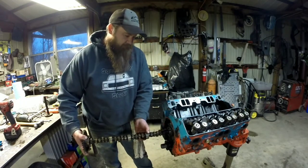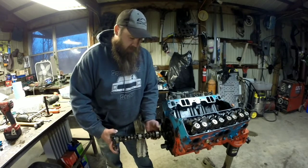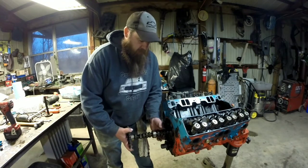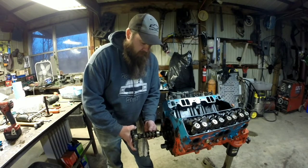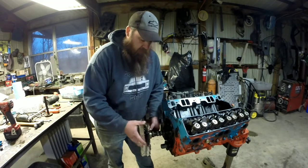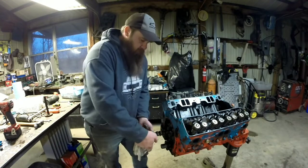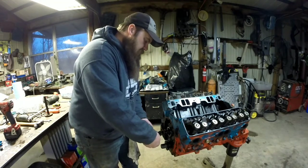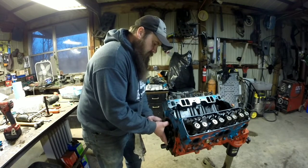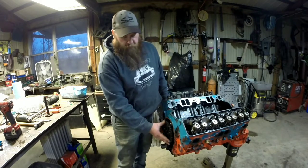I'm going to go ahead and put it back in, same way, with the gear. You may not have a special tool or holder to bolt on the end of your camshaft and you just got to use the gear. And you can do it with just the gear — I've done it with just the gear for a long time. Once you get to the last lobe like that, just grab ahold of it, nice and easy. You can feel it kind of get slid in there. Camshaft's installed.